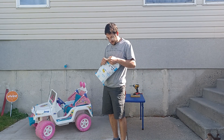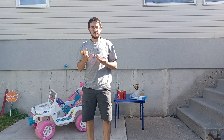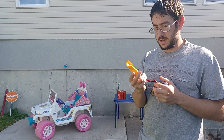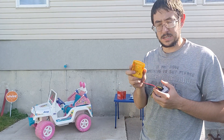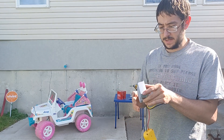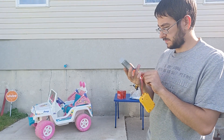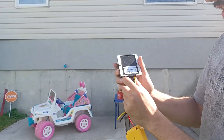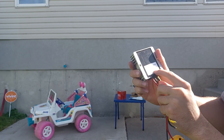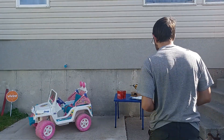I'm going to open that up here. So what this is — it's an adapter for a DeWalt cordless battery, the 20-volt max ones. And then this is a step-down voltage converter. You can see the input is 20 volts, output is 12 volts with a max of 15 amps, which should work pretty well for us.